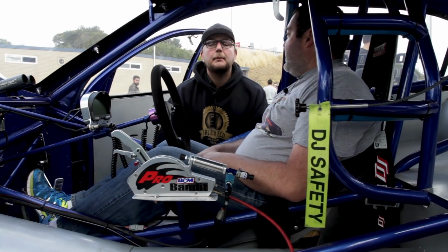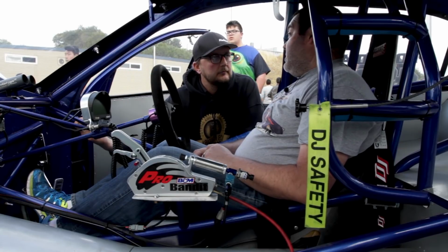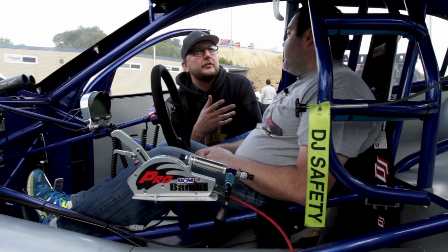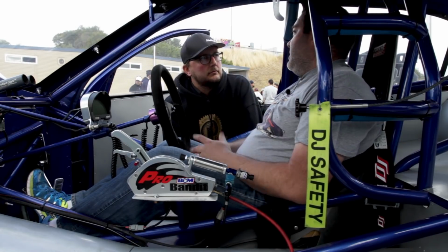What gearbox and how many speeds? It's a Turbo 400 and it's 2-speed. So they take first gear out and you'll basically leave it in second gear. It takes off on what would have been second. Second gear, yep. So it's got a 1.48 first gear and a 1-to-1 top.